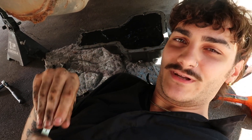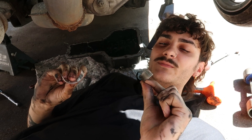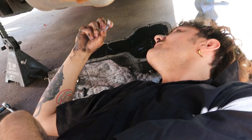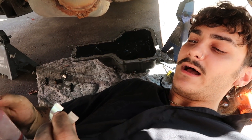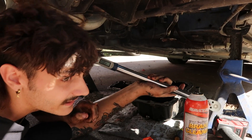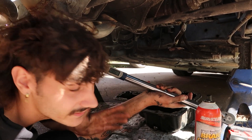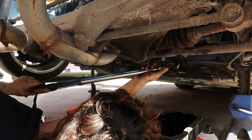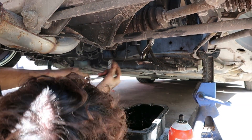This isn't the cleanest engine building space, but comparing the old bearing to the new one you can tell they did get a little scratched up. There's nothing on the crank though, and I don't feel anything on the rod cap or con rod itself. I'm applying ultra slick engine assembly lube liberally all over, then popping it back in and torquing it down — 15 foot-pounds and then 90 degrees. Technically you're supposed to replace the stretch bolts, but we're going to send it.